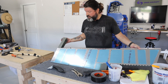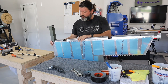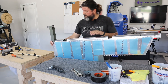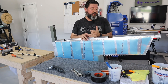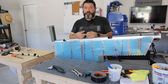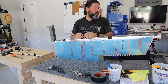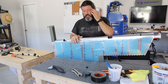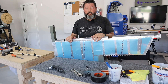The other thing I did was I rolled and riveted the leading edges. This was every bit as frustrating as advertised, but I think it turned out pretty well. So today I'm going to do the edge rolling on the rudder and the right elevator and get that done. I also screwed in the counterweights completely and torqued them. I'll do the same thing on the other two control surfaces for the empennage. The shop's a mess from yesterday's work — I finished late, like 11:30 — so I'll get cleaned up and get into it. Stay tuned.